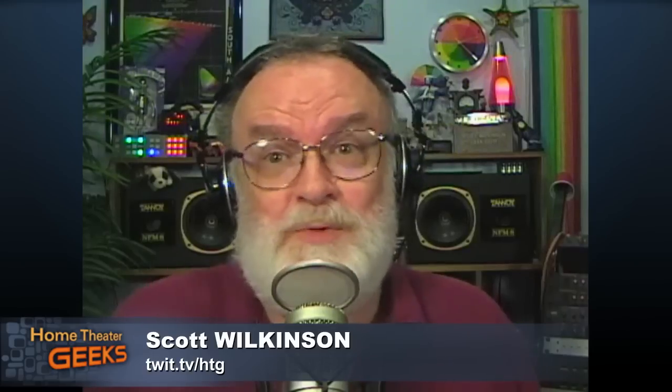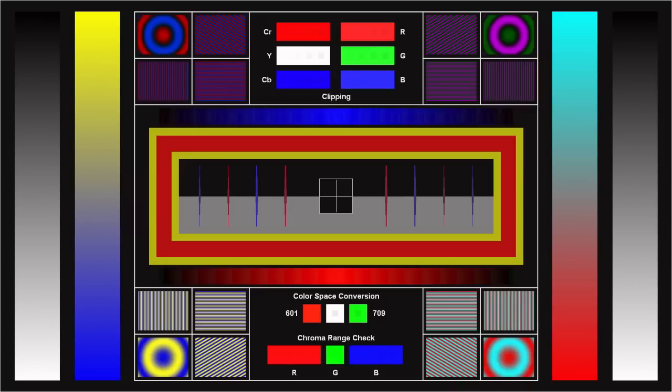There it was. That was a really quick look. Just a tease. All right, little bit more. It's really about what color space you use to transmit between the player and the display. Keep in mind the player, all the bits on the disc are in 420, and the display must display in RGB. Somewhere along the line, it must be converted between these other formats. It has to go to 422 and 444 and then RGB. And so the real question is, who's going to do that conversion?